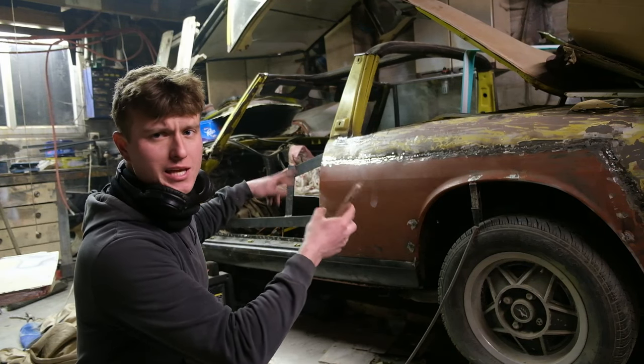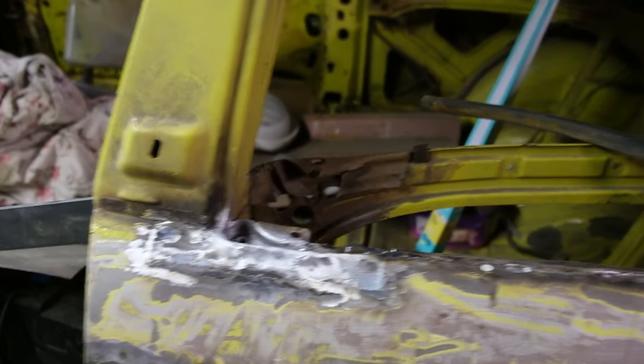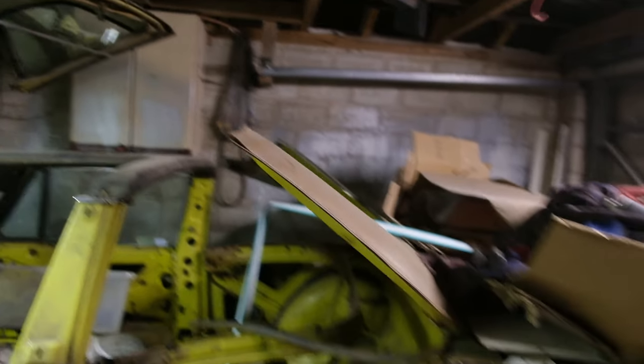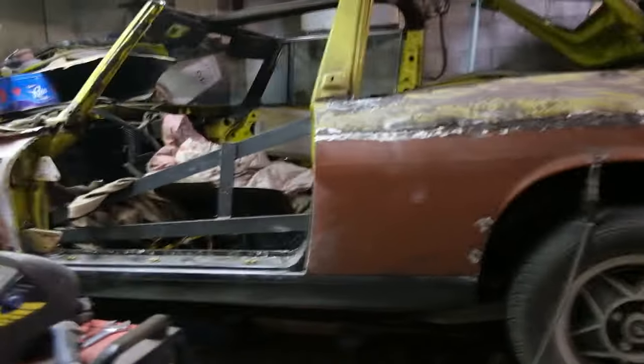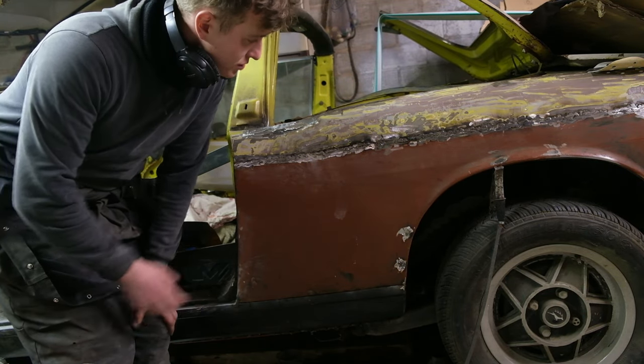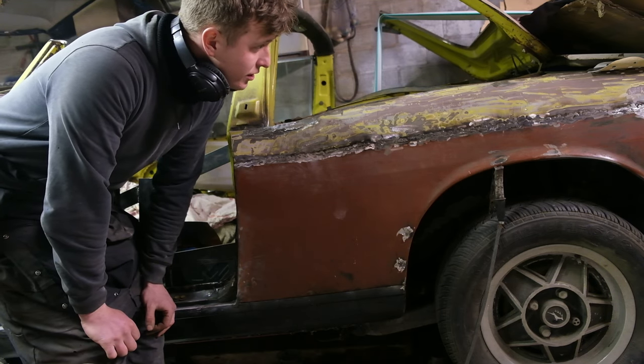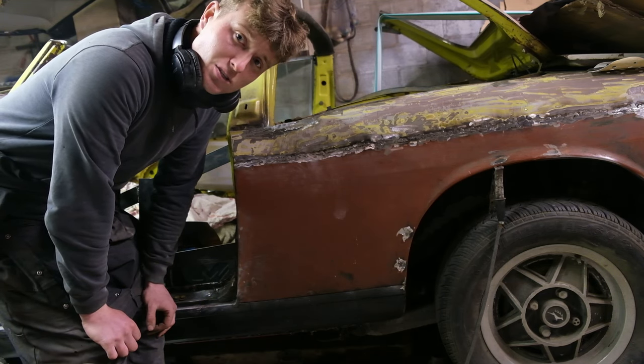Welcome back to the channel. I've raced along a little bit. I've tied the hardtop — not sure if it's repairable — to the roof, and I've also done some repairing of the rain rail at the top. I've still got a little bit to do there, but I need to whip this panel off at the top and give the whole panel a skim of filler. With quarter panels you never do get them perfect — they always require a slight skim of filler — and this one is no different, although it isn't too bad.